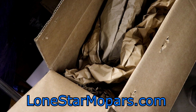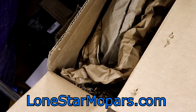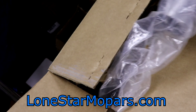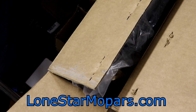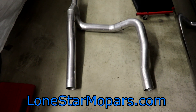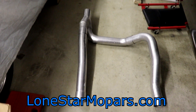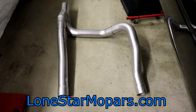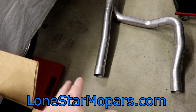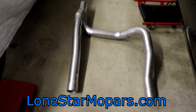This is how the crossover came packed — lots and lots of packing, looks to be done really well, exhaust is bagged. We've got several different runs of pipe here — one will head off towards the cat. Laying it out roughly, you've got your Y heading off to the factory cat, you've got the crossover with the slip joint, and the run over here on the driver's side. It's kind of a straight shot from the passenger side.